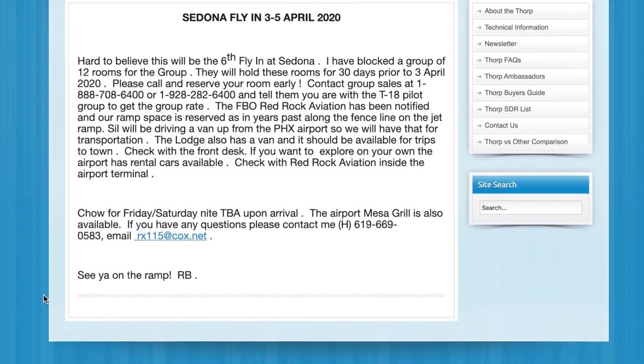I went online to the Thorp online community, which is actually a very strong community, and looked at their suggested entry speeds for those standard maneuvers, loops and rolls. And then the goal for this flight was to go out and demonstrate them. Build-up to a roll is pretty straightforward. Once you've established the airplane has enough roll rate or enough roll power at a given speed, you're just marching your way through the rolls as you work from a higher speed down to a lower speed. And since the suggested speed, which I believe was 180 miles an hour, was so fast relative to what I would consider a min safe speed for the airplane, I was able to march that down pretty quickly.